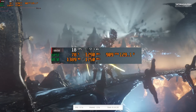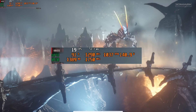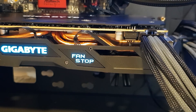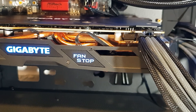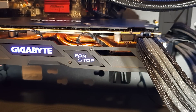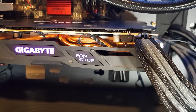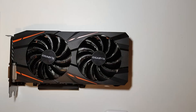As mentioned earlier, mining cards are generally run 24/7, and this card has been doing that for almost a year. Sure, it's running completely in spec and that's not really going to damage the GPU in any way, but it will dry out the thermal paste. When the 480 is amply fed and using more power to hold the quoted 1290MHz boost clock, it quickly became apparent the card was struggling to keep cool, heading to well over 70°C. So I think we should get this card out, strip it down, and see what's going on.